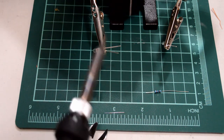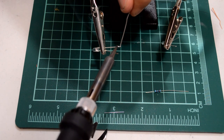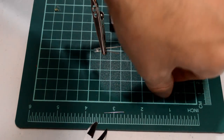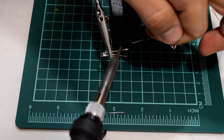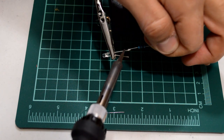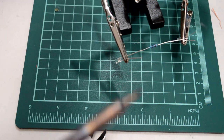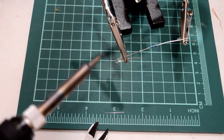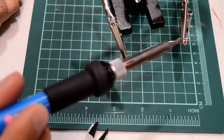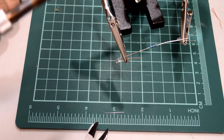We start by putting a little bit of solder on the edge of the LED, tinning it up, then reheat it and join your resistor. So now you have the resistor attached to the positive leg. We're just going to redo that three more times on the other resistors. Don't worry about the other leg — we can trim it down later depending on exactly how we set it up inside the faceplate.